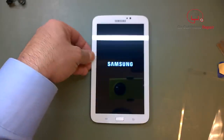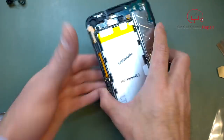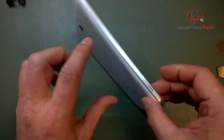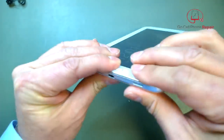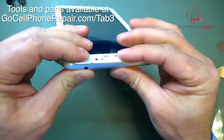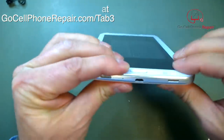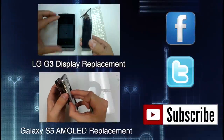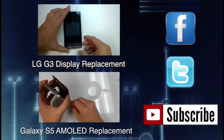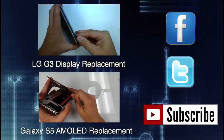The last thing to note is that when you go to put the panel on the back, the clips are a little bit funny on this device. On the left-hand side, you have to go all the way around and make sure it snaps in all the way — there are a couple areas where it looks connected but doesn't quite snap on completely. I usually just work around the perimeter a couple times to make sure it's nice and flush all the way around. If you found the video helpful, hit the like button and feel free to share it. Visit us at GoCellPhoneRepair.com — thanks for watching.